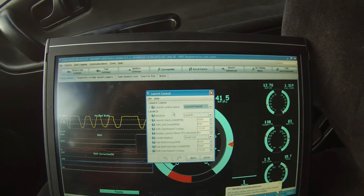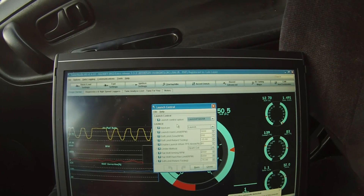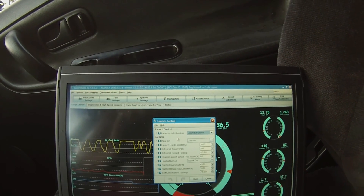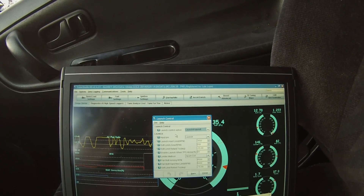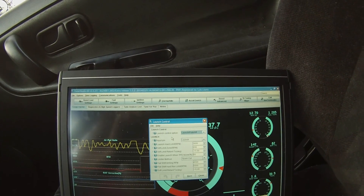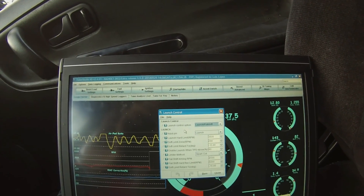So basically I have launch and flat shift — I like the flat shift, don't really use it, but see my launch input pin. I have 3600, stop zone limit 200, 15 degrees retard, enable it after 80. I do spark cut — I don't like doing both spark and fuel cut because I want to see some fireballs, but also you need that fuel to spool up the turbine. And then you see the flat shifting settings there.